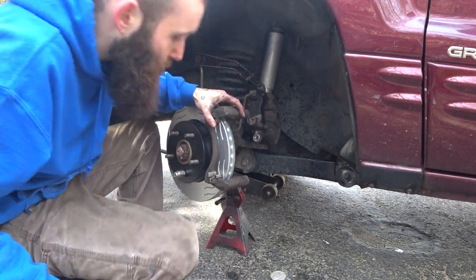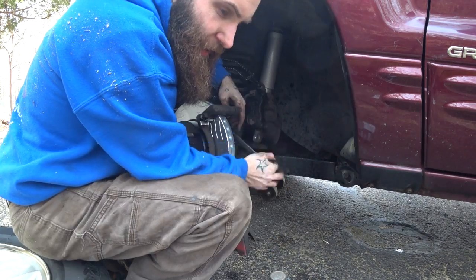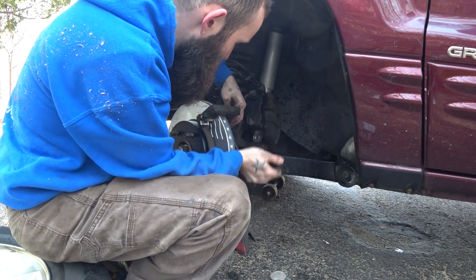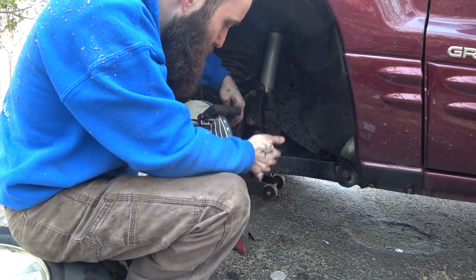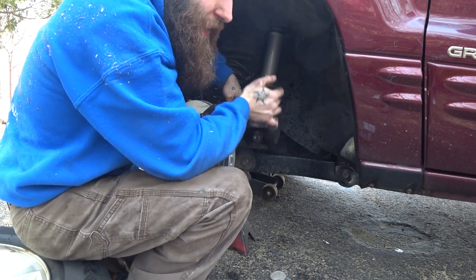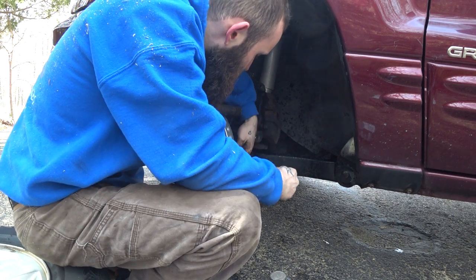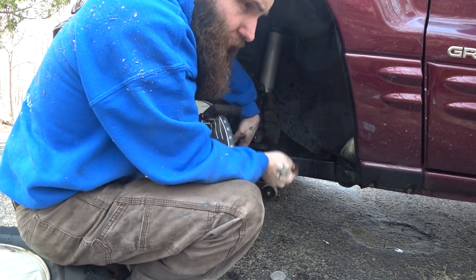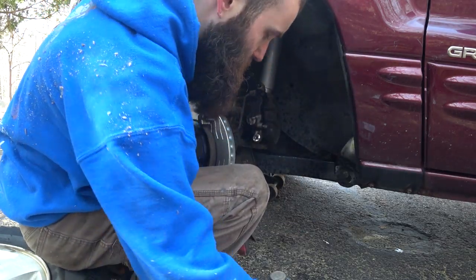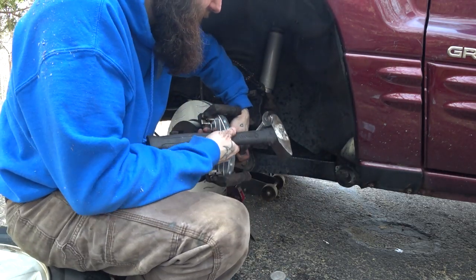Those hunk of American cast irons that I just took off were the absolute dirt cheapest option. Now another factor — Eric and I were talking about this over the weekend — it's not just your rotor that comes into play when talking about the life of a rotor. Your brake pad material definitely makes a difference. If you have a real hard brake pad material, your brake pads are going to last a good long time, which is awesome. But there's a very good chance that you're going to wear out your rotor because you're putting excess heat into them. I've kind of been getting whatever was cheap and then on sale to make it cheaper. Maybe I was doing myself a disservice.